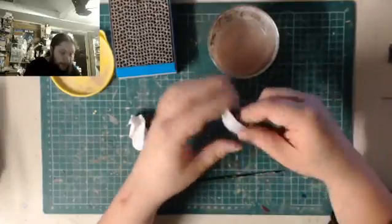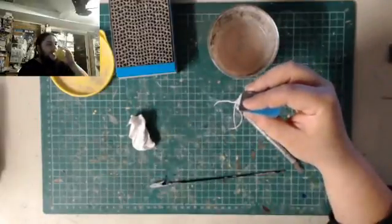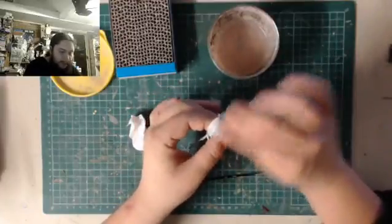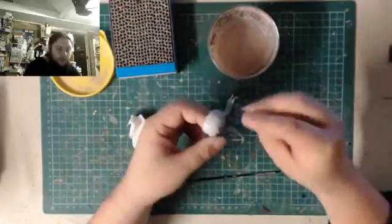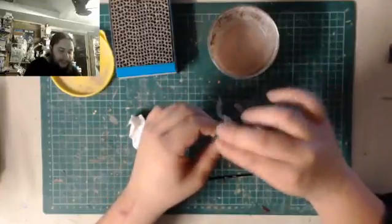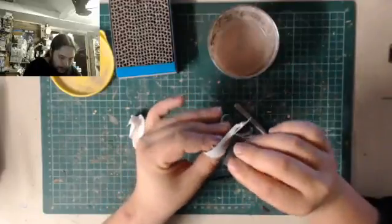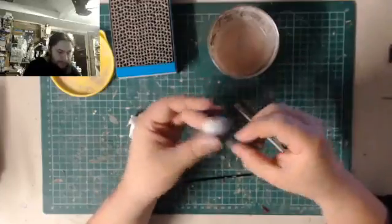And polishing paint and primer and whatnot can only occur when the paint's completely dried and hardened. You cannot polish paint that's skinned, or only the surface is hard but underneath is wet or puttied or whatever, because you're just going to scrape the dried skin and expose the putty and leave all sorts of ungodly marks and scratches and a terrible texture. So most of the surface doesn't have to be reprimed, it's just polished, it's just nice and smooth.